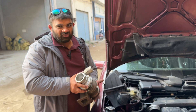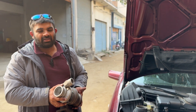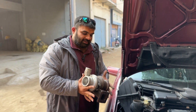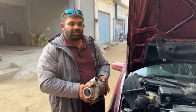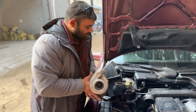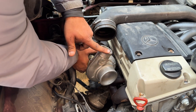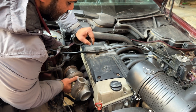We'll be doing a boost test on this post installation. If it does match the 1.3 to 1.4 bar requirement, there are no second options we'll be going with. The reason being, this is a very compact turbo that will match with the HX35 or the HE250 — similar performance but at a much smaller size. In the car we are constrained for space, so the hot end is going to sit here and the inlet will be replaced by a steel pipe.